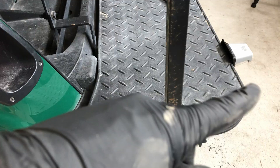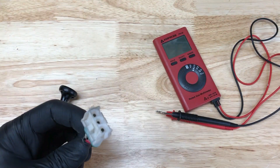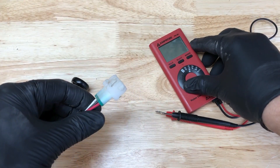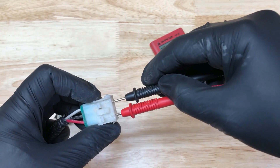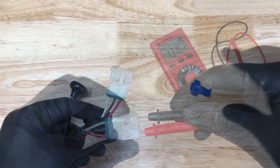The light will get power from our tail light, with wire routed through the wheel well and under the cart. Let's look at how to grab power from the right wire. I've hooked up my old wiring harness for demonstration purposes. I've turned on the headlight switch and I'm using the multimeter to see which wires are positive and negative. I've identified the red wire as positive and the white wire as negative — your colors might be different.